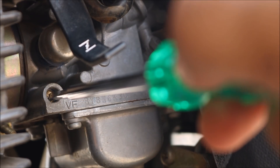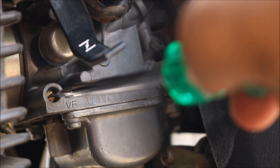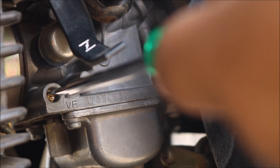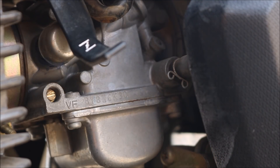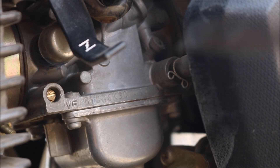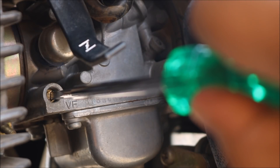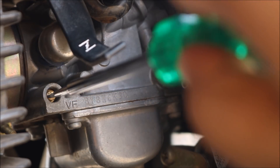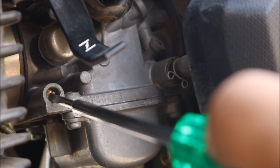Now start opening the screw in the anti-clockwise direction. Count and remember each turn, and finally stop when you are at 3 turns. If you notice the screw position now, it is less than 3 turns. This is my present state of tune which is working efficiently for me, but this exact setting might not work perfectly for everyone. So I am suggesting a range — one can start with this exact setting, and if needed the screw can be turned a quarter turn up or down accordingly.